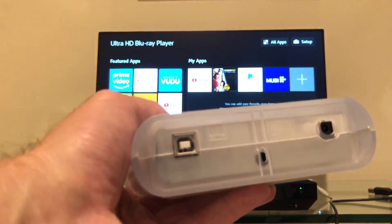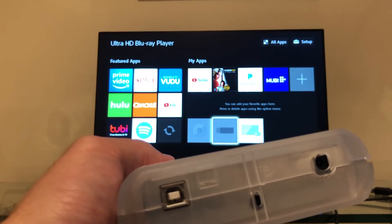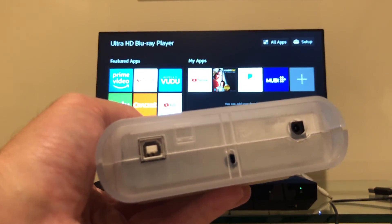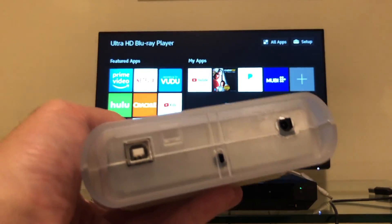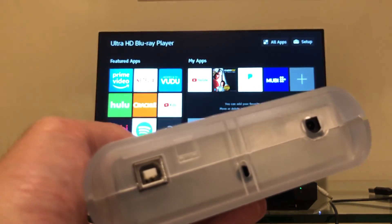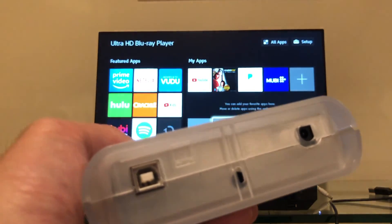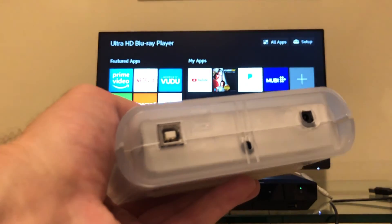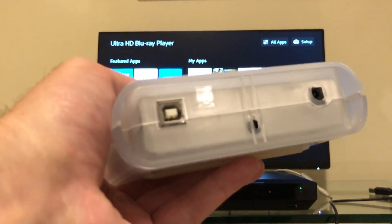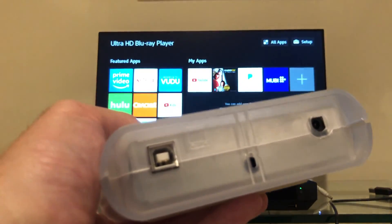They have a proprietary connector on the back that you plug a special USB cable into. It looks like a mini SCSI 2 connector, but it's not — it's its own thing. Those drives don't use USB mass storage; they have a proprietary driver. Oddly enough, that driver is still baked into Mac OS X, so even today you can use those on a Mac. There is a Windows driver that I believe still works under Windows 10, but that's it. So if you want to use anything other than a Mac or Windows, you want the M3 model with the USB Type-B connector, which uses generic mass storage and should work on really any consumer device that hosts USB devices.